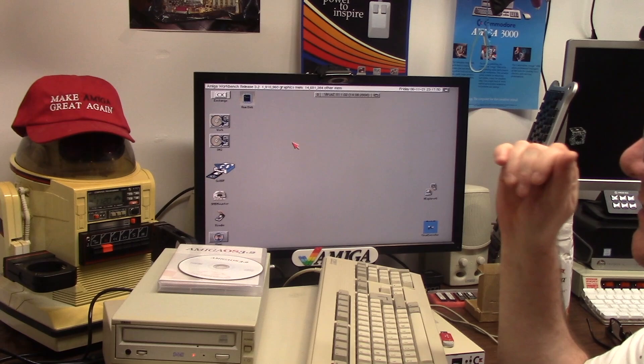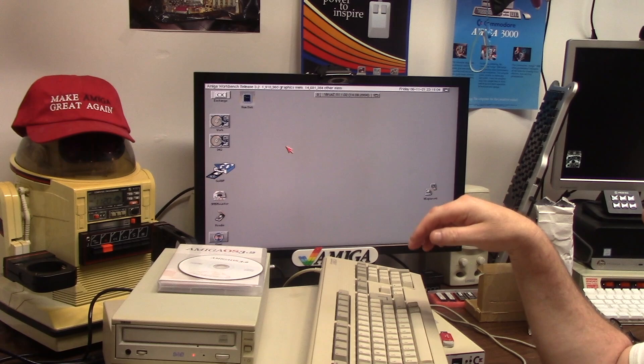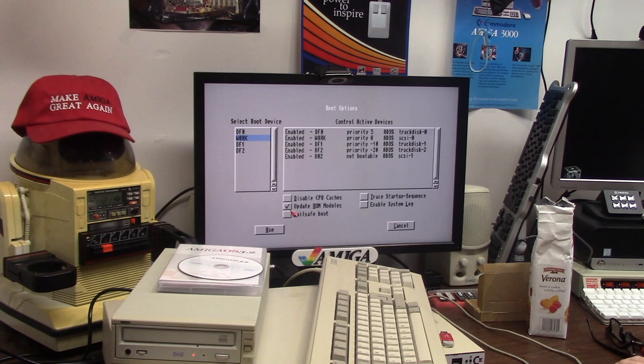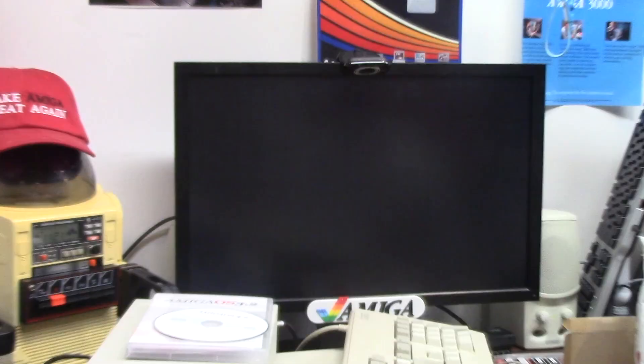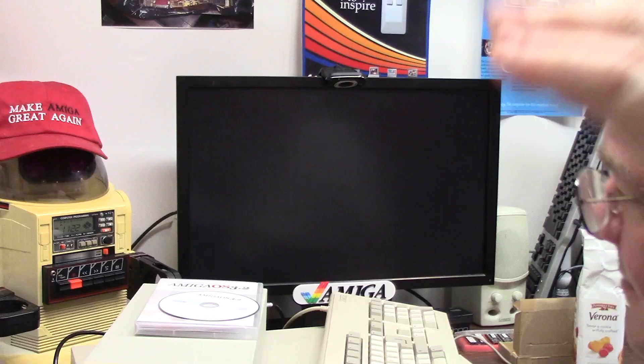In my case it was in user startup. Will the safe boot mode work? Probably not, but let's try it anyway — hold both mouse buttons down when you reboot. Go into boot options, choose your bootable device, and select fail-safe boot — it's the bottom option. You can enable a system log too. We're just going to say fail-safe boot and boot to see what happens. There we go — fail-safe mode, features have been disabled, it's in a safe environment.